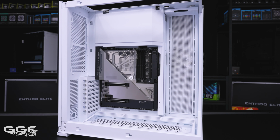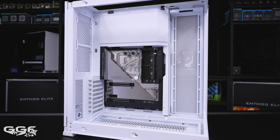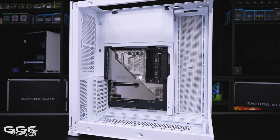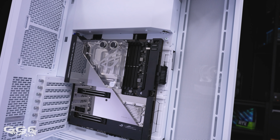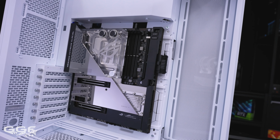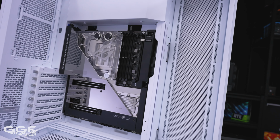I just love this look with the motherboard installed and the RGB covers back in. All cable holes are basically hidden. Motherboard support is of course up to EATX, and I had no issues with 24-pin routing as the cable grommet is far enough over to not be an issue with EATX boards. SSI CEB motherboards are supported, but cable routing may be tight.